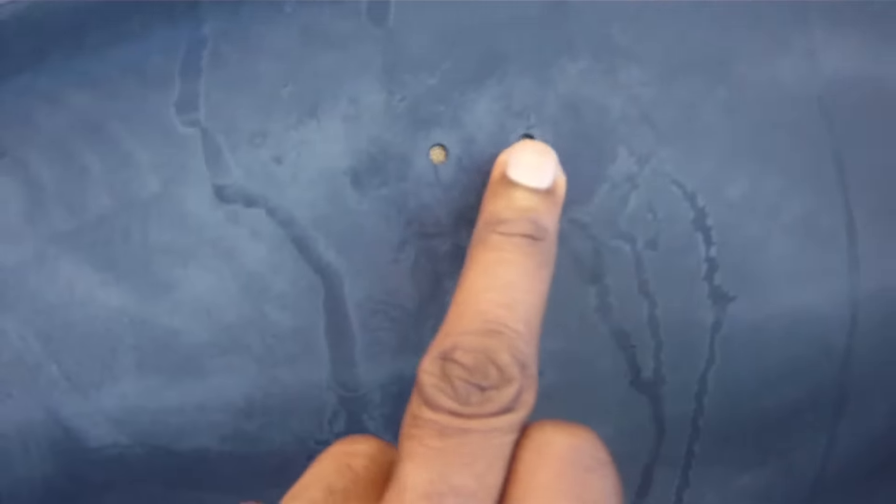What's up everybody, your boy JMax. So my boy just dropped off his bumper a couple days ago — horrible condition — to get painted up. What he wants me to do is fill in the holes, as you can tell. This had a big piece for the license plate, same thing here. I'm going to use a wire mesh in the back and then fiberglass it. This bumper is in really bad condition, so let's see how good I can bring it back.